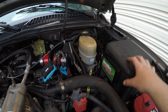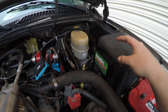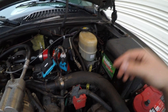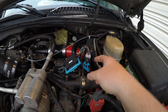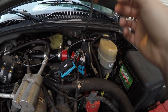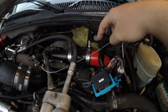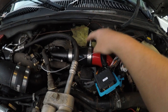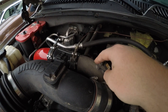Here's everything installed on the truck. The tuner mounts right to the side of the electrical center. It comes with some peel-and-stick Velcro on the back, so you can easily remove it and put it back on later if needed. These main bulkhead connectors — it's just as simple as unhooking the harness from the computers and then plugging it into the Banks tuner, and then the connectors on the Banks tuner replace the main harness going into the computers. So it's an inline tuner that intercepts all of these signals and modifies them. Back here you can see the hot side — the intercooler comes with new couplers because it maintains the three-inch diameter tube all the way up to where it connects to the turbo and also to the Y-bridge of the intake.